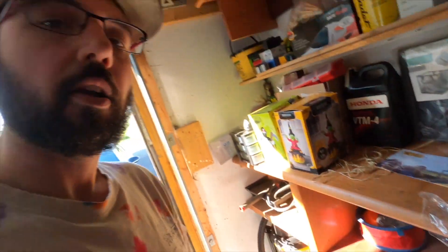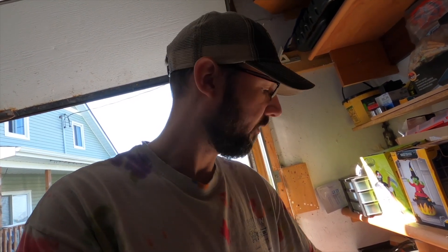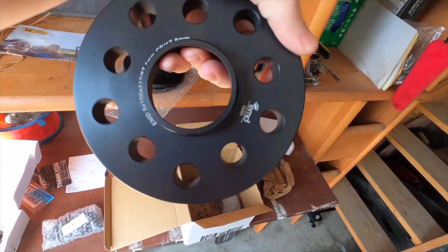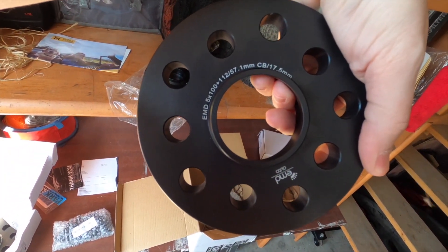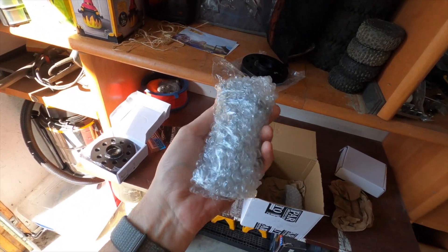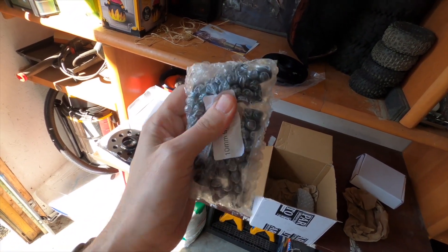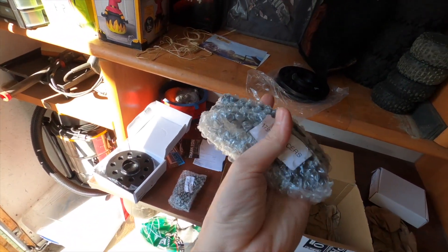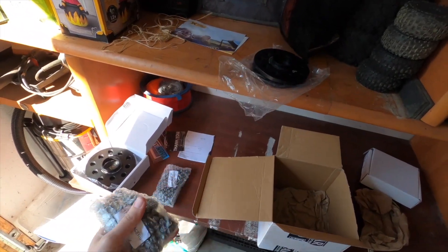That's the specs for the front. A lot of the flush fit kits you'll see have 10 front and 20 rear, some have 15 front and 20, some are 10 and 15, some are 10 and 12. This one is 10 front and 17.5 rear. This is my EMD rear — the 17.5 spacer. When you order these, you get new hardware: new wheel bolts of the appropriate length for the front, and extra long bolts for the rear to accommodate the 17.5 spacer.